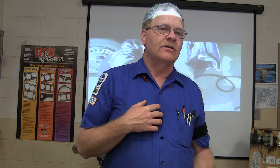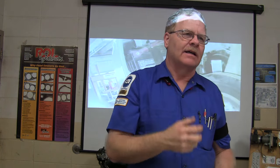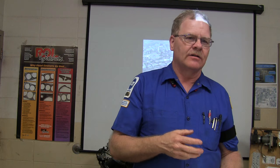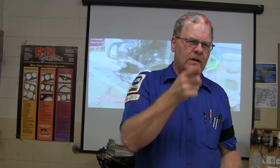Okay. What's wrong with this one? It was lying about the amount of alcohol that was in a Tahoe that we were working on, and it was making it start hard. Why? Because if it thinks it's got alcohol in it, it puts more fuel in there when you're starting it and it's wetting the spark plugs. All I had to do was call them and ask what they were running in it, because the scan tool showed 45% alcohol. And they said, we never use that crap, we always use plain old gas. That told me the sensor was telling a lie and causing issues.